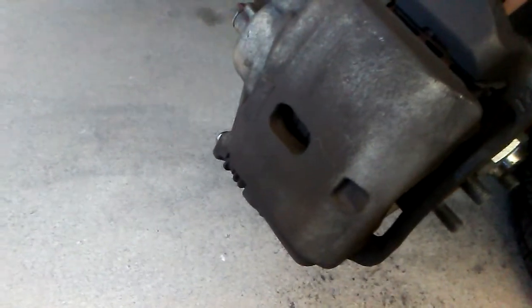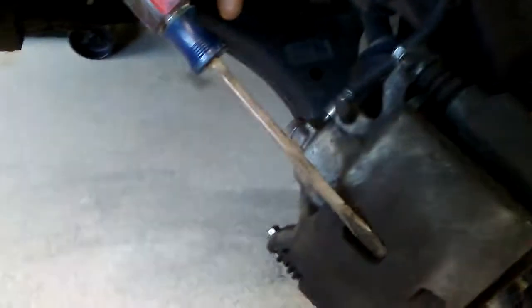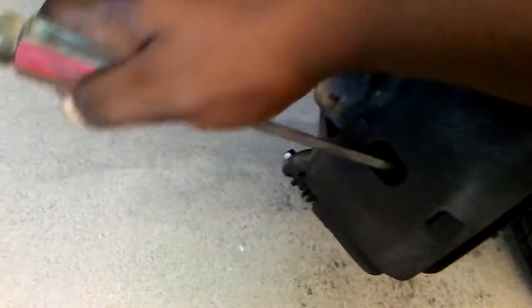Turning the steering wheel gives you way better access to your brakes. Now this next part is very important — since you're not flushing out the system, you don't want to have to put more brake fluid in. That's where the big screwdriver comes in. Put that screwdriver inside here and pry that brake piston back. Get a good grip and keep prying it back.